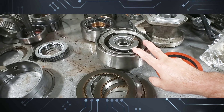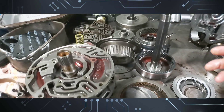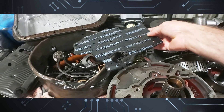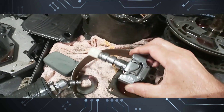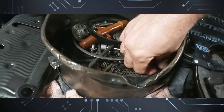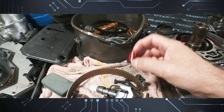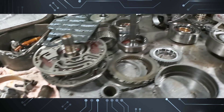That's what we're going to do with this one — upgrade it to that spec. As you can see, it's just a regular 400 transmission but this one has a Transgo manual kit, so it's not automatic. The governor is locked, and it doesn't have a modulator either — there's a plug where the modulator should go and the modulator valve is also blocked. This has a full manual setup.